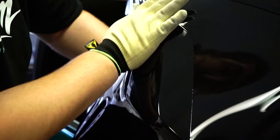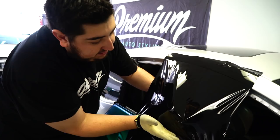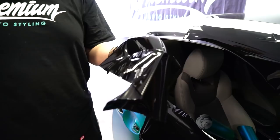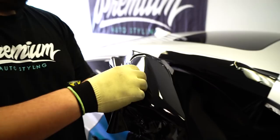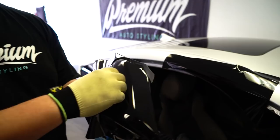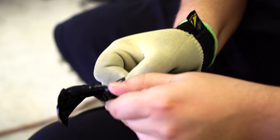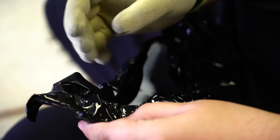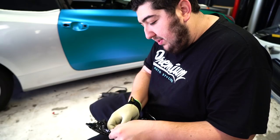Just like that, we got the two-thirds of the mirror wrap — the main face of it. Now the last part is this hard bend. Again, not gonna be stretching, just pushing in place with heat. There's just a tiny bit of tension here that we're gonna kill with heat, but all around the other corners everything's super clean. That's why it's important not to stretch — you can get it to look super clean, paint-like finish, with just a little bit of pressure. So at this point we have it all wrapped around the corners. We're gonna gently set everything in place, give it a nice post heat, make sure nothing's moving, make our cut line, post heat one more time, and then we're good to put it back on the car.